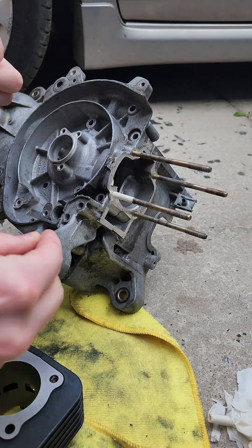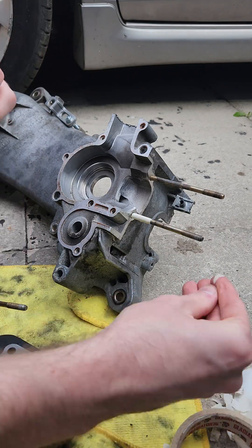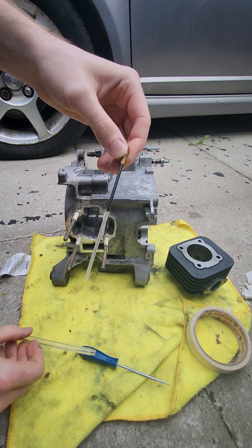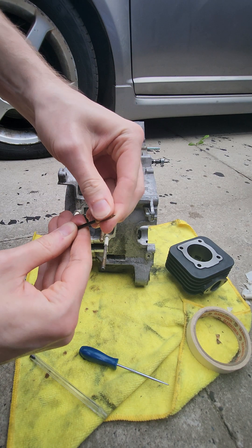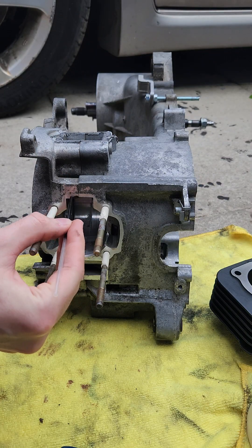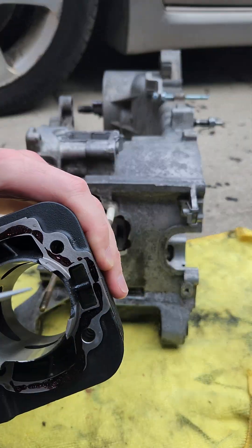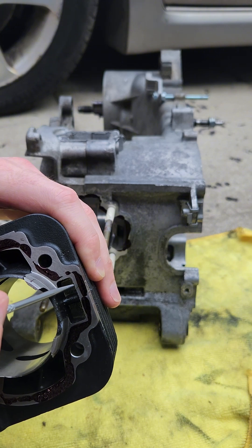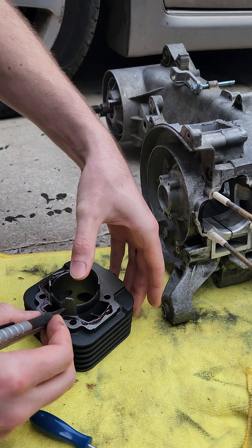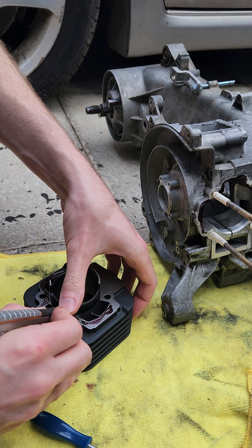I'm just going to wrap a little bit of tape around these engine studs to take up any space, because when you slide the cylinder kit down there's just a bit of wiggle room. Then we take a pen, remove the tip exposing the ink, and use that ink to mark on the cylinder so that when we slide it down onto the crankcase it will leave a nice outline showing where metal needs to be removed. Now I'll take a knife and score the cylinder kit around the ink, then wipe the ink off — that gives us a nice metal scoring mark to show where I'm going to be grinding up to with the Dremel.